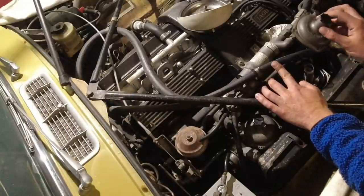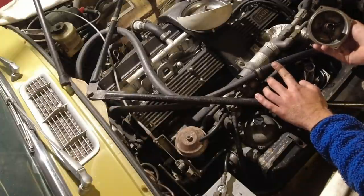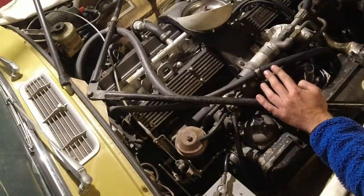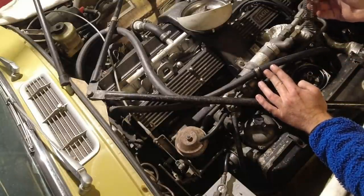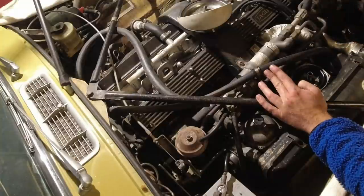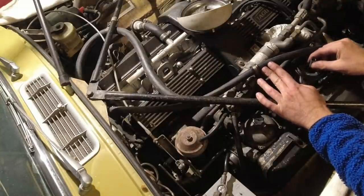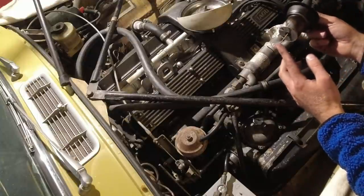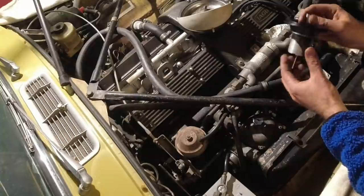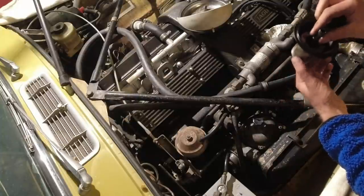So here is a top, and we'll clean this up, and I think we're going to polish it a little bit for him. I think he'll like that. We have a spring. And we have a piston with a tapered needle on the bottom, just like SUs. Looks very similar. And we have the diaphragm,